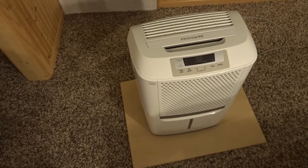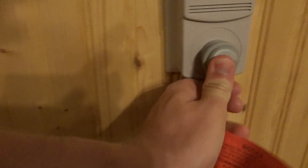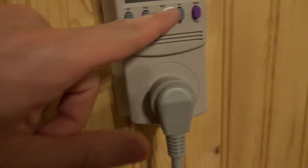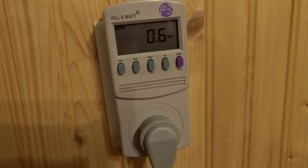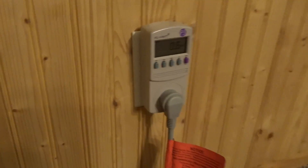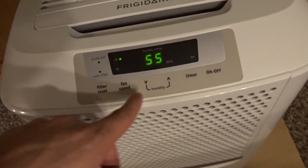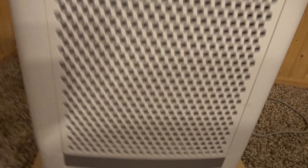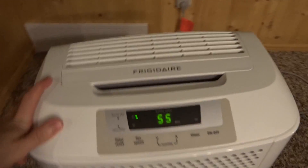What I've got is a Kill-a-Watt unit here. I'm going to leave it plugged in — and interesting to note, the unit still has somewhat of a power draw even when it's off. We're going to go ahead and fire this up. I'm going to keep it in watts and then do a 24-hour energy test to see what this costs to run. It is on high and the tank is empty, so we should get a good day of constant run time.